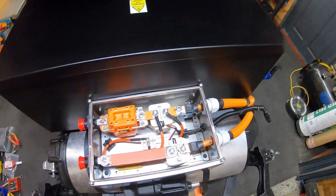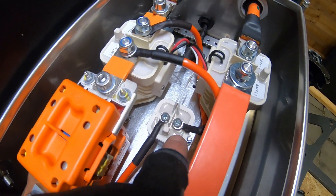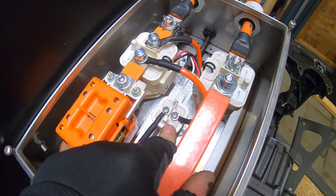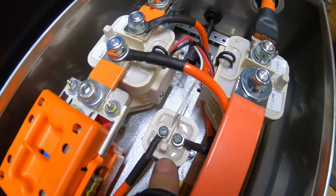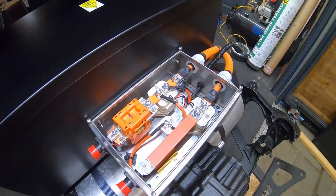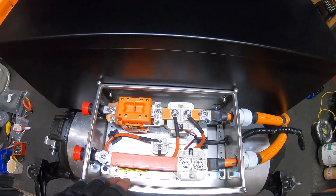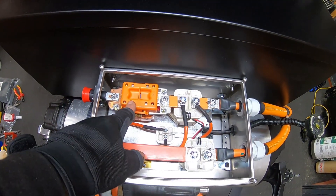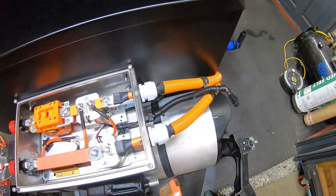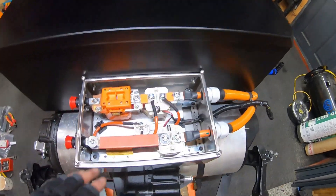You may be wondering what this little one is. This smaller contactor is called the pre-charge relay. It's not as heavy duty because you don't need it to be. You have to have one of these — and it's again a safety thing. The idea is you don't want the full voltage coming straight through into your electric motor, because it could potentially damage the inverter.